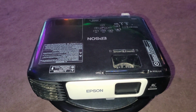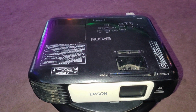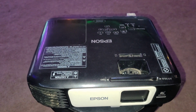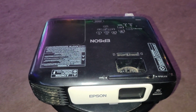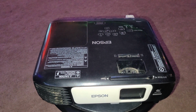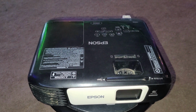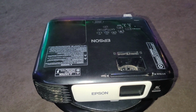What's up, guys? I'm going to show you how to change the lamp out of an Epson EX9210 projector. One thing that is very important is you want to make sure that it is unplugged and that it's been sitting for a little while, as you don't want the bulb to get hot, because the bulb can get very hot when it's in use. So you want to make sure that it's been sitting a while so that it doesn't get hot on you.